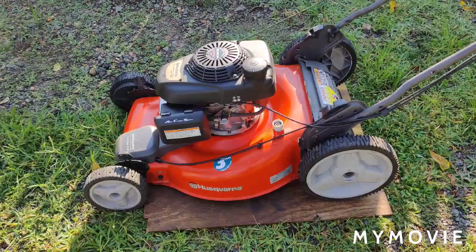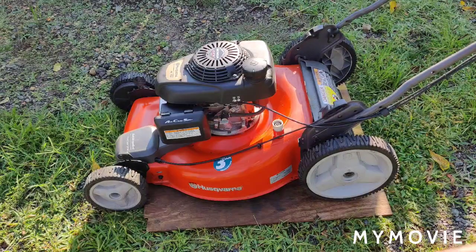The choke comes off. My experience with this wax-mounted choke is that the choke should be off within 5 seconds after you start it. You know? So that's why I'm leaning towards the throttle linkage. It's just missing that arm on it to pull the choke off. But we'll see, like I said, when we get the new carburetor.